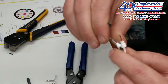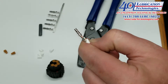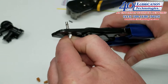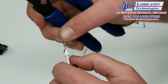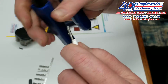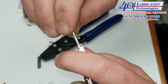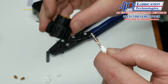I'm going to go ahead and make my connection on the white wire. Again, we have our connector on the wire. We take our crimpers — pin number three is going to crimp the connector onto the copper wire. Again you shouldn't be able to pull that off. And then we're going to take number one and crimp the insulation seal onto the pin. You can see the pins slightly penetrate in there so as it goes down it's going to take the seal down with it.